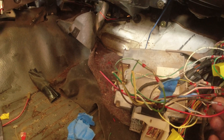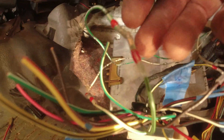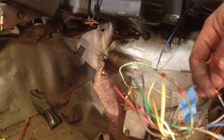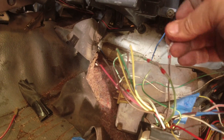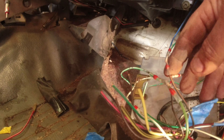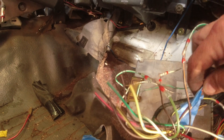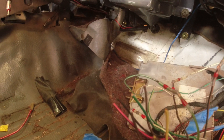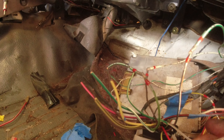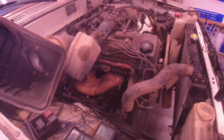So: green with black, white with green - that's two. Then there's a solid black wire - that's key-on power. Black-red, that's another one. White with red, black with red, and white with blue - that's the Toyota Tacoma end of it. The black with yellow is constant battery, that's keep-alive memory, and the black with white with black stripe is ground, which is pretty typical on most Toyotas no matter what year. That squares that away - that'll get the computer happy enough to make this thing run.